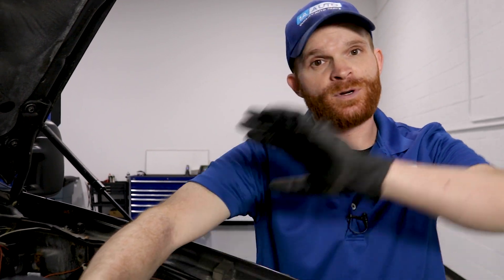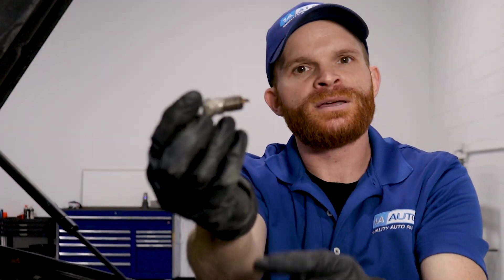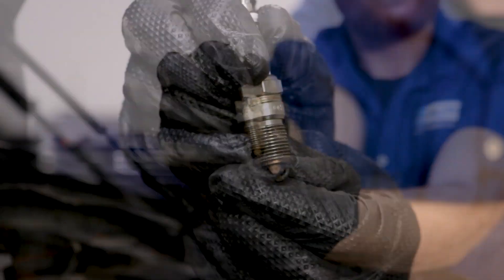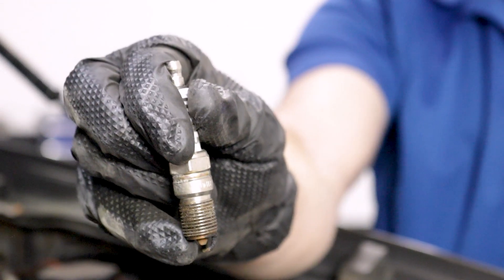After 2002, Ford fixed the problem, so if you get something like that you don't necessarily have to worry about this. But if you're looking at something prior to 2002, let's talk about it a little more. When you go to service these spark plugs, what you're probably gonna notice is you go to pull them out, you're gonna hear a little creak and almost a snap, and the next thing you know it almost feels like there really isn't any pressure. You go ahead and pull out the spark plug and you've got aluminum on the threads of the spark plug. At that point you've actually stripped out the threads inside the aluminum head. This fix isn't necessarily the hardest, but it's a little bit difficult, especially for the rearward spark plugs, and that's gonna be the most common area where you'll find the issue.